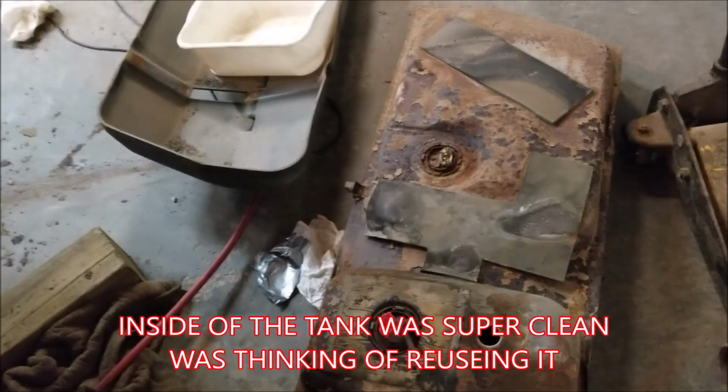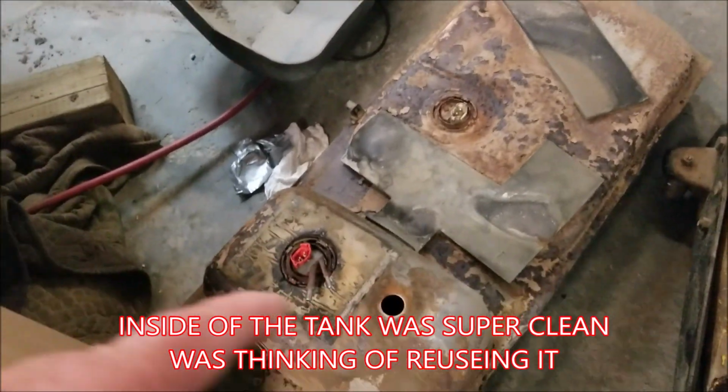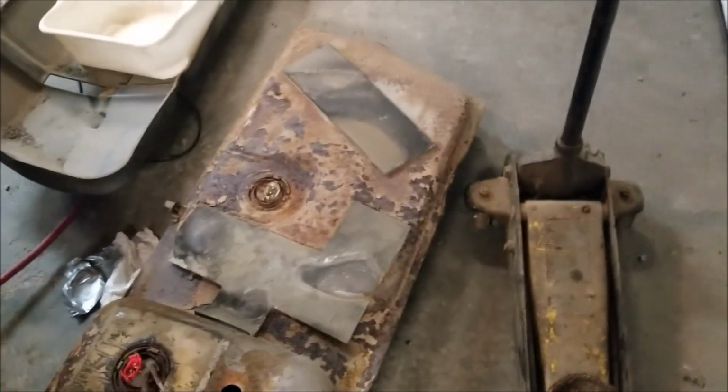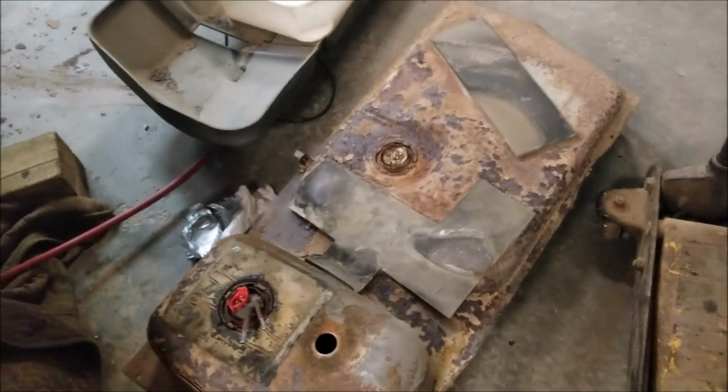So we put a new high pressure line on it, and I was going to put the tank back in. But like I say, then I saw those grommets. Figured, well, no use putting the tank back in without the grommets. Put in the grommets, and then when I put the fuel tank over, I realized it does have a little pinhole leak in the fuel tank as well.